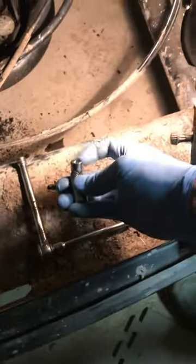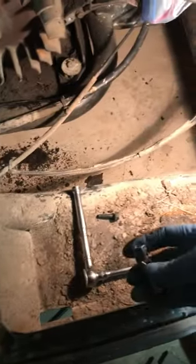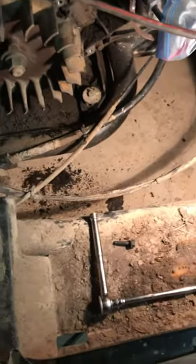The flywheel cover is not too bad to get off. You got that one, that one. This bottom screw down there is a real pain. Here's how to do it. Just need a little joint swivel, this extension, and a 10 millimeter swivel, and that'll get in there and get her off without taking off the floor or anything like that.